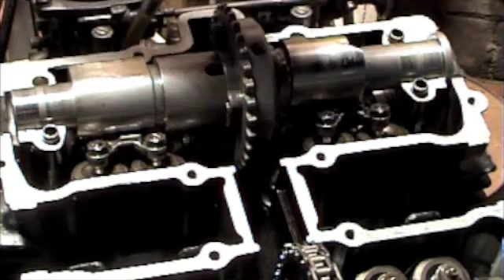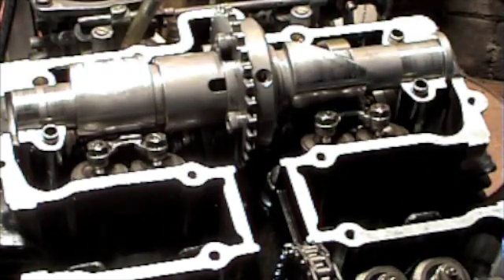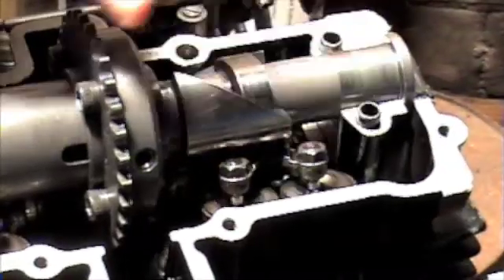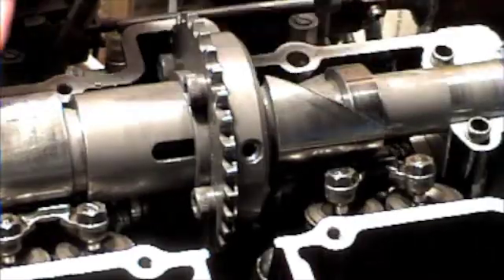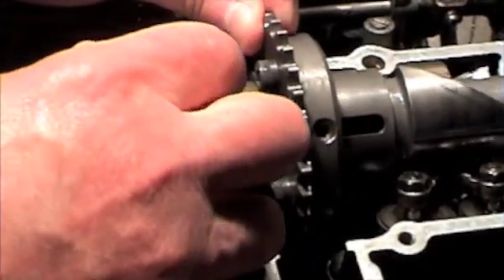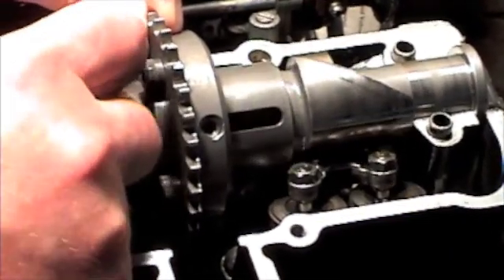It could be separate ones if you're keen. But basically this thing has no real disadvantages, except that it's probably a little bit expensive to make. This actual helical machining has got to be done very carefully, because if the helical machining on this and on the inside don't all line up, it tends to bind when you're actually trying to adjust it. When you adjust it, that pocket stays still. So it's all on the late closing side of the lobe.